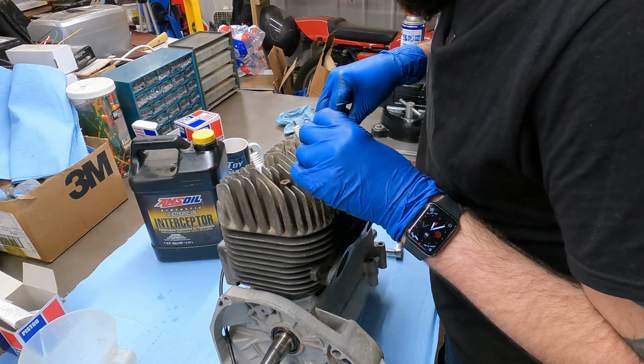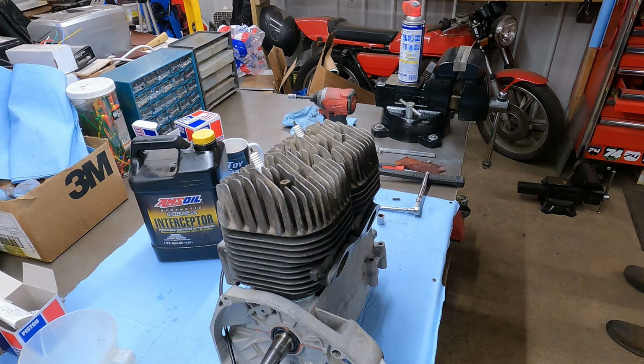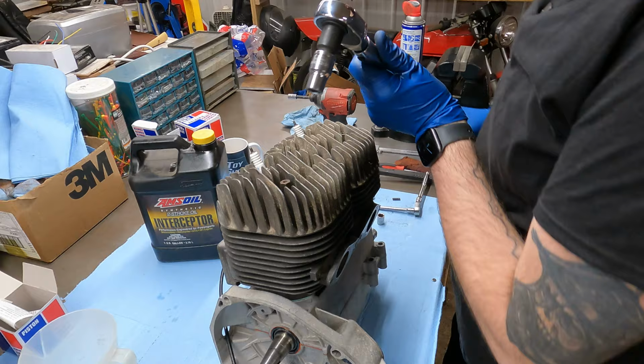But back to this, let's get these little bolts put in that just help to hold the head together. All right, so all those are run in pretty hand tight. The nuts are gonna be 20 foot pounds and the bolts are 11. I'm gonna do the unthinkable and put a short extension on this, and do it for all of them so they're even. We're gonna go to 20 foot pounds and send her right home at 20. And kind of half bear hug it here.